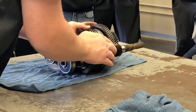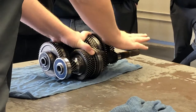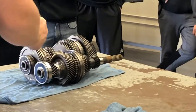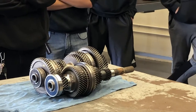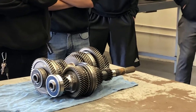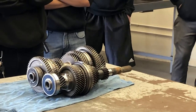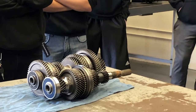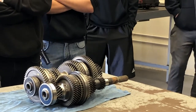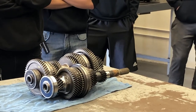If I want to drive down the road, all I have to do is first push in the clutch so I'm not putting power into the input shaft, and then lock one of these gears to the back wheels - that's the decision the driver makes. If I decide I'm at a stoplight and I want to start in fourth gear, I can make that decision. I did it in third - it was such a slow start. I got a car to move once in fifth gear, although you can smell the clutch. I just wanted to prove I could do it.